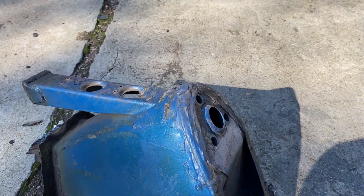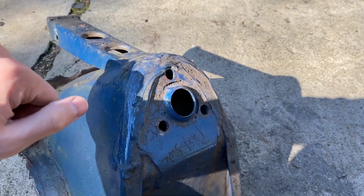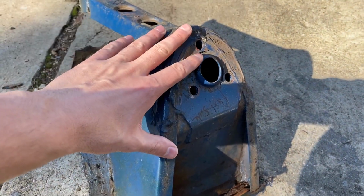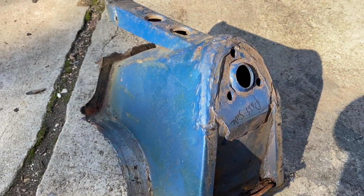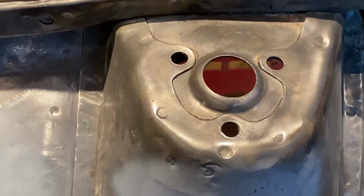As I was saying on the last episode, the reason why I'm doing this is the donor shock towers. It seems like they were trying to put in some camber plates in the stock one, so they cut all this out here, and they were messing around on the side here. So I just wanted to leave everything all in one unit if I could. I cut them out of the donor car with the plasma cutter, and I still have to clean everything up on the sides. But I just want one unit to replace everything with, and not have to worry about piecing everything together. That is such a structural component to holding the rear suspension up. Luckily on the front, they didn't mess with that at all, so lucked out there. I don't have to replace the front, only the rears.